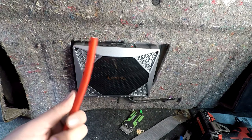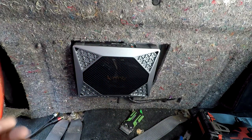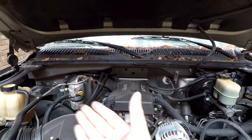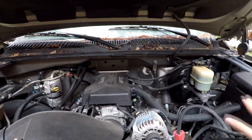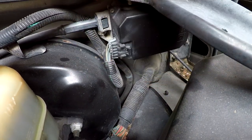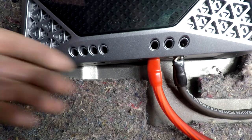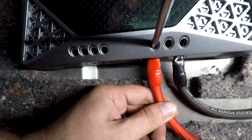For the power wire, figure out whether you want to go down the driver side or the passenger side — that's determined by where the wiring harness grommet is. Look in the engine bay to locate where the wiring harness goes through the firewall. On this 2000 GMC Sierra, it's right next to the brake booster on the driver's side. So we're going to route the power wire through there on the driver's side and then route it through the cabin.